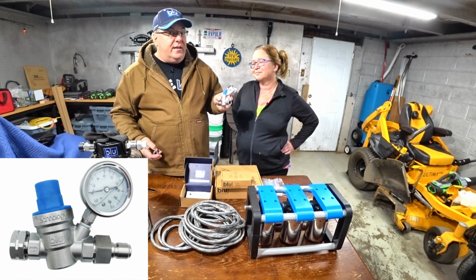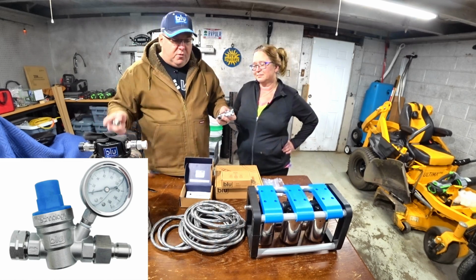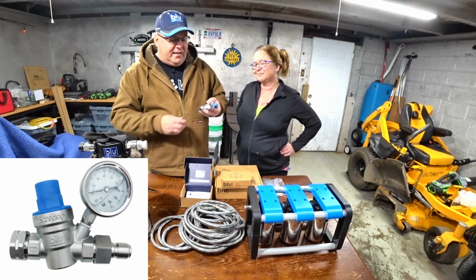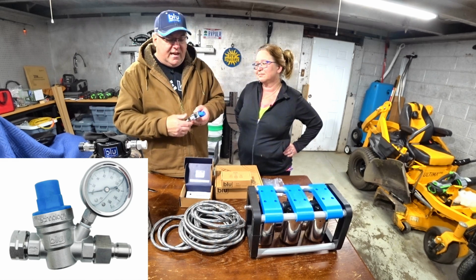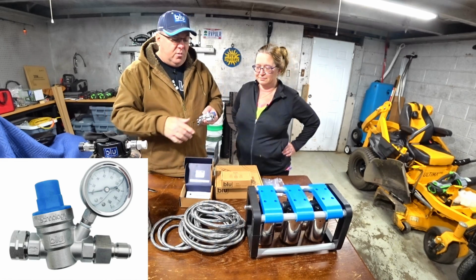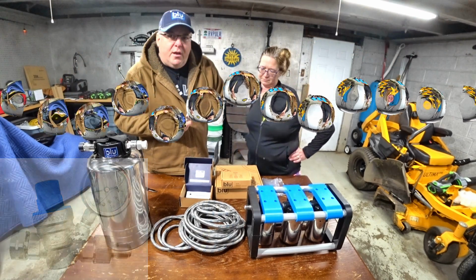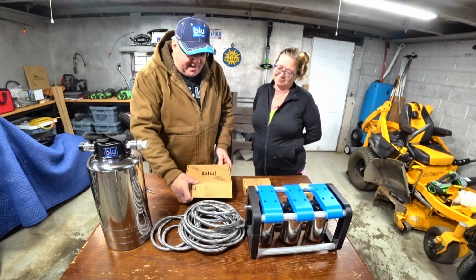So pressure regulators are definite when you're out there on the road. And again, if you've got everything perfect, stainless. Now they recommend 60 PSI. Anything above 60 PSI could damage the filters. It could damage everything. So stay below 60. Okay, and before we get into the last piece, which is really, really cool, I'm telling you.